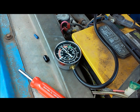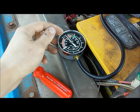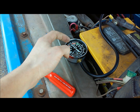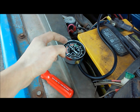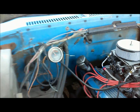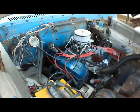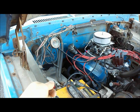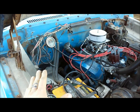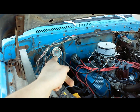We've now reached the point where we've come to maximum vacuum on our engine, and the needle is starting to pull back down the more I lean it out and starting to hunt around. So we're going back to that highest point of vacuum. Note: if you're reaching maximum vacuum at more than two and a half turns out, you're usually going to be leaner than that — or you have another problem in your carburetor. You want to do this evenly across the carburetor until your manifold vacuum reaches its highest point.